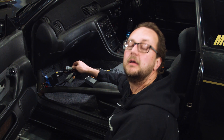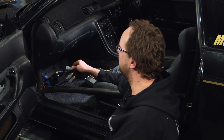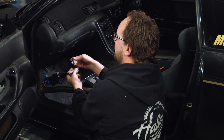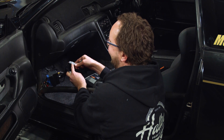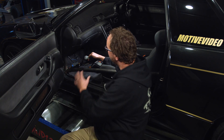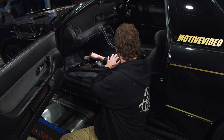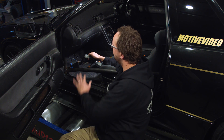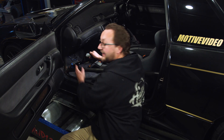We've got a bunch of breakout harnesses. This one's labelled drive-by-wire, so it's got the inputs and outputs required when this car finally gets converted over to full drive-by-wire. We've got a connector labelled gear load cell — so our gear position signal as well as our load cell signal come into the Elite Series ECU through this auxiliary connector. There's a spare connector with a bunch of spare inputs and outputs for future development. We've got our CAN bus connector connected to our CAN-based wideband controller as well as our CAN-based dash so everything can communicate together. And lastly, we've got our auxiliary connector — this has our oil pressure sensor, fuel pressure sensor, and external manifold pressure sensor, as well as our flex fuel sensor that gives us ethanol content and ethanol temperature.